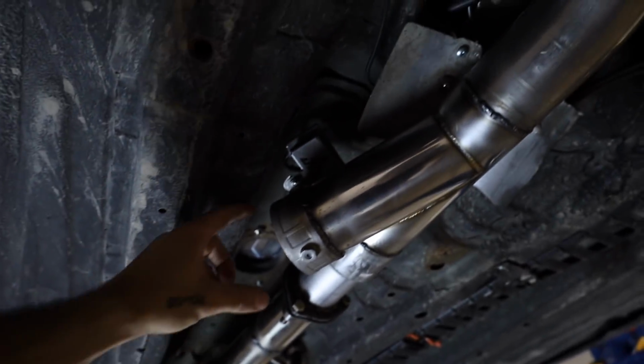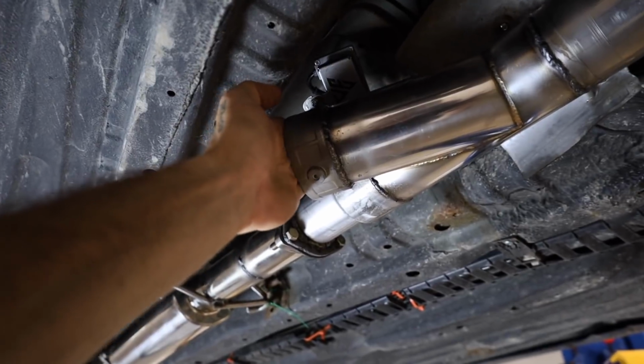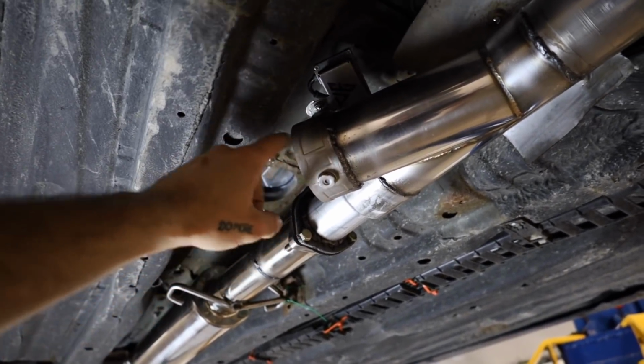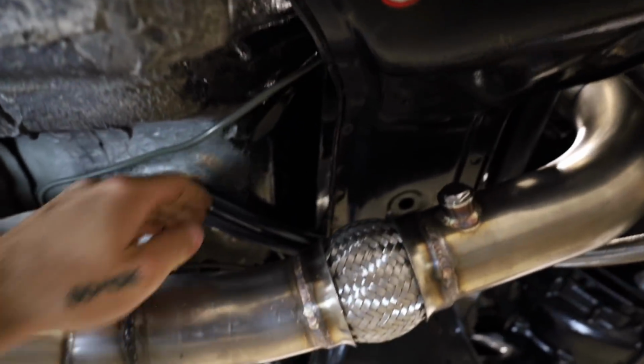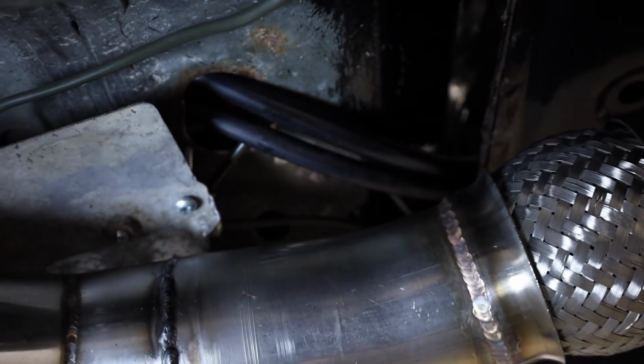So I'm gonna go out and just buy a little 3-inch 90, and then I'll do whatever modifications I have to make it fit on this, and it'll kind of just turn down away so it's not blasting up against the frame. Everything is bolted up, has frickin' clearance for the first time in its life. Cables are routed up there. They come down through the chute, go up over the subframe, no fear of melting. So all we got left to do now is we gotta route this little wiring box thing.